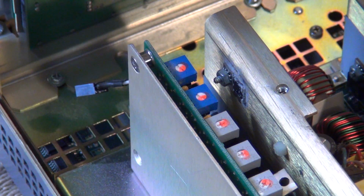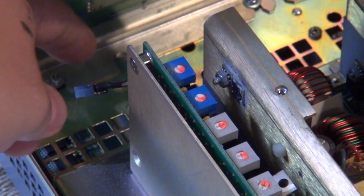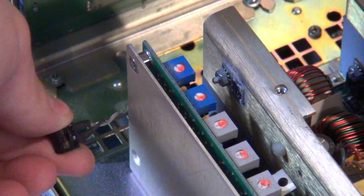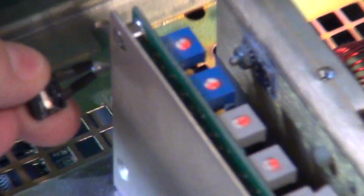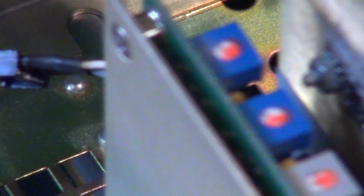It led me to believe that it was a mechanical temperature sensor that was closing or opening based on temperature, like the distance of the 2 metals. And sure enough, look at the data sheet, and that's what it's doing. I can see if you can see the 2 contacts that are still remaining in there. With the contacts open, it's not in shutdown mode, and with the contacts closed, it shuts down. So the way it must have broken, the other piece of metal that was in there was flopping back and forth and intermittently contacting and putting the oscilloscope in shutdown mode, rendering it useless.